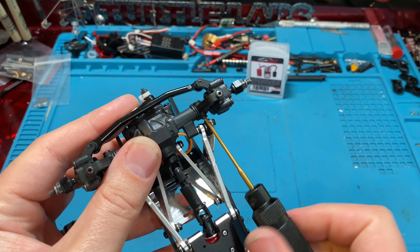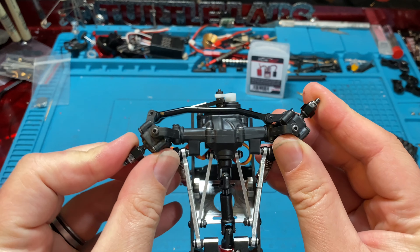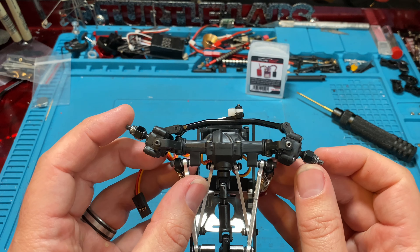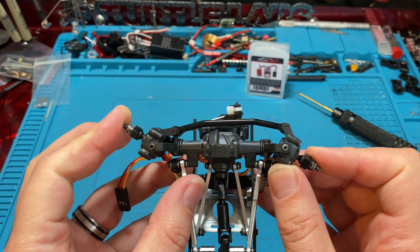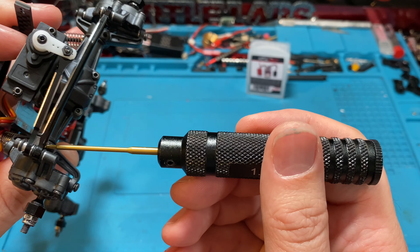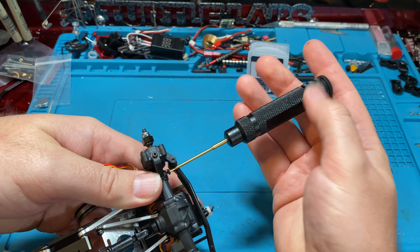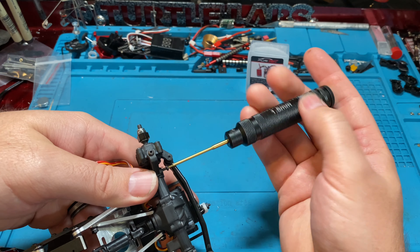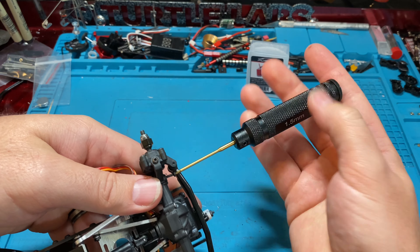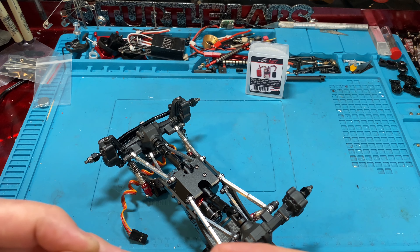It's seriously as simple as pulling the screw out and throwing it on the other side. You can see the angle there versus that — that's a big difference. It's pretty extreme, and it's just because the steering link hits on those little screws. Hopefully FMS in the future will assemble these axles with the screws in the rear. It was one of the first mods I did on mine — just a simple moving of the screw gives you so much more steering.